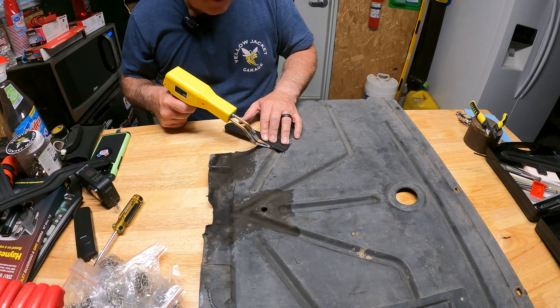And it comes with a bunch of different rods for different plastics. It has some mesh screen in here — you can cut different sizes to do bumper repairs and stuff like that. The part I was really looking forward to was all of these clips. These are basically staples that go in the end of the tool. You turn it on, heat it up, push it in, and the staple goes in there. Let off the button, and as soon as it hardens up, you pull that off and clip the tips off the staples. It kind of has a squiggly that holds your plastic together. There are a bunch of different types, styles, thicknesses, and shapes. You'll probably find what you need, and you've got enough that it'll outlast the life of the tool.